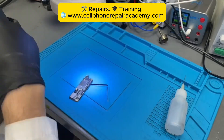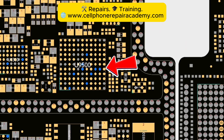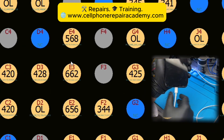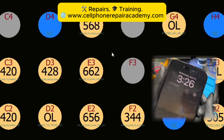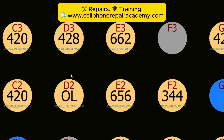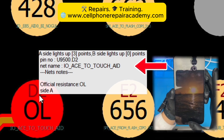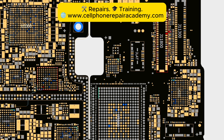Let's find out. The first place we look is the USB-C control circuit, and there's one chip that stands out: the U9500 IC. This chip is responsible for authenticating whatever gets plugged into the USB-C port. If it fails, the phone won't recognize the charger. But that's not all — the U9500 also manages a line called TouchAid, which helps power the touchscreen functionality. So if this chip dies, you lose charging and touch.